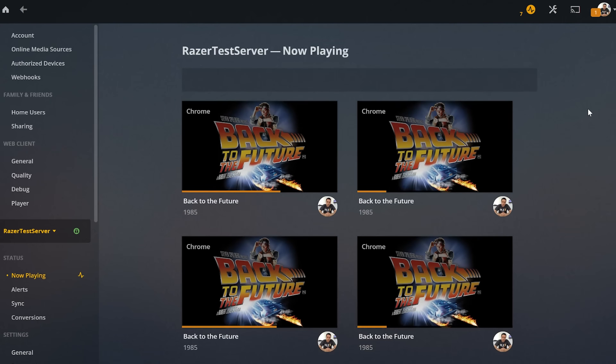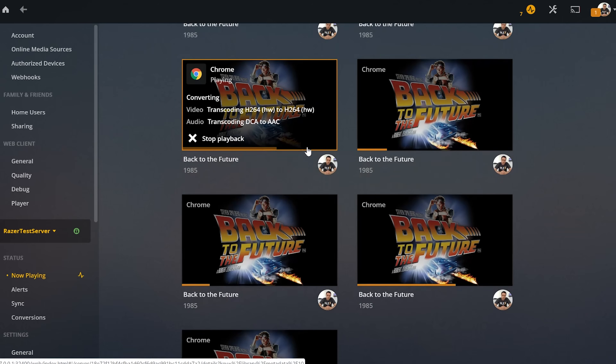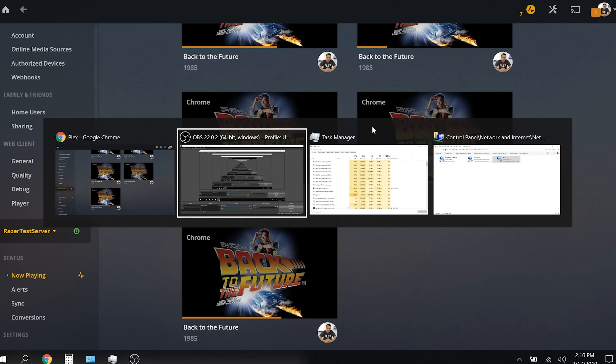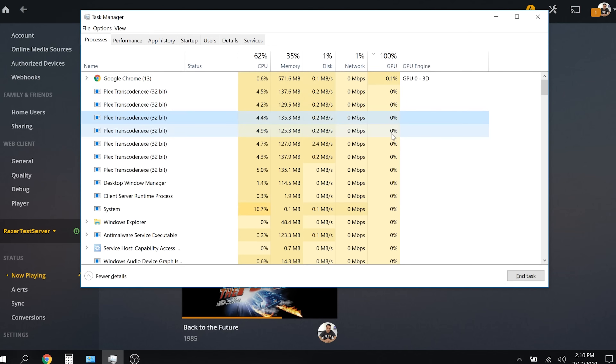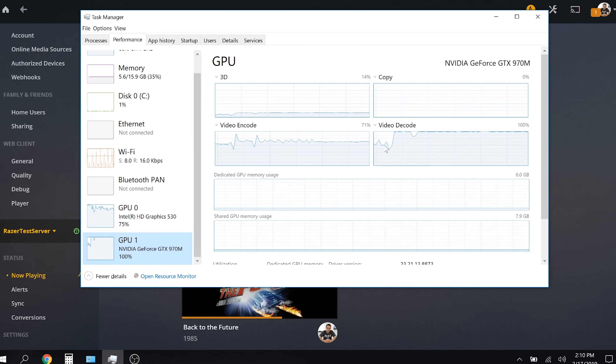So I set out with Windows 10, the 388 Nvidia driver, and did some baseline testing just to verify before I started patching and messing with things. Lo and behold, I found out that, as far as I can tell, the mobile version of this GPU is not locked — which is kind of interesting. This is a Plex Pass feature, so I had to log into my Plex account to enable hardware-accelerated transcoding. Once enabled, I used my main computer in Chrome to play different versions of Back to the Future — a 15 to 18 gigabyte 1080p MKV file — transcoded all the way down to 2 megabits per second. I started another stream, then another, and another, and it just kept going. The Plex UI was showing hardware-accelerated decoding and encoding on all the streams.